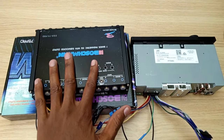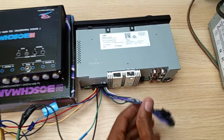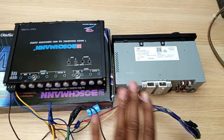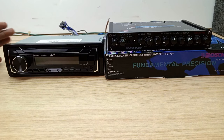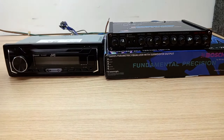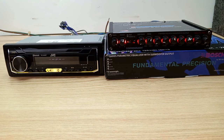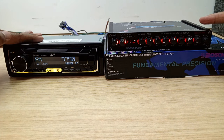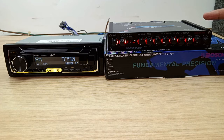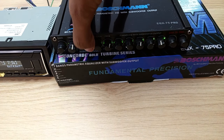When you use an equalizer you will not use any of the speaker terminals on your radio — I've isolated those since I'll connect my speakers to my external amplifier. With the power supply on, when I turn on the radio this equalizer automatically turns on as well. The equalizer does not have a power button; it relies on the external input from your source, the head unit.